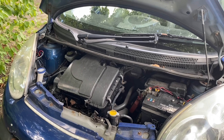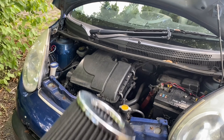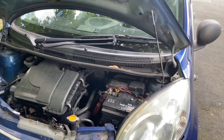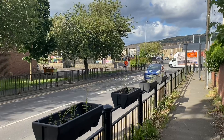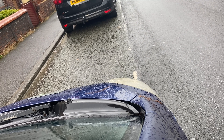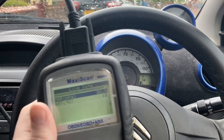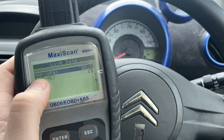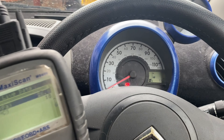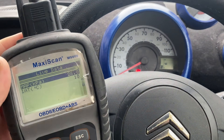Before I fit any of that, I need to get some baseline tests of how it is now. I'm going to try and test how fast it is, test the MAP pressure on the manifold to see if it's actually scientifically doing anything, and I'm also going to test the sound — because obviously that's the most important. Let's go and see what it's like now.